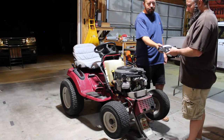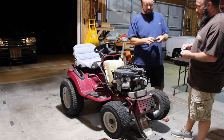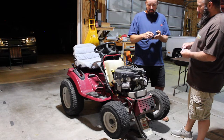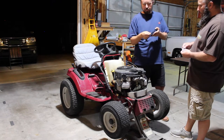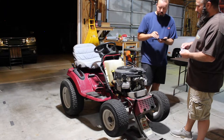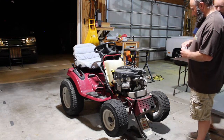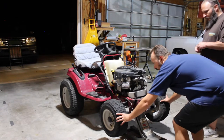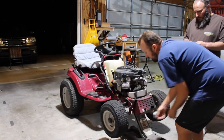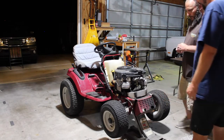In the investigation of the steering gear, I believe it's the steering plates, these little bushings in here. They just wear out after time, and they're intended to do that. So if there's any wiggle in there, all that moves and shifts so that your wheels pigeon toe. As we take this apart, we'll be able to see what was happening. Whenever I would go forward or backward, that was the movement in the wheels, and that much tension, with a fat guy out there on the lawn, it'll break those. So here we go.